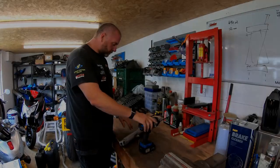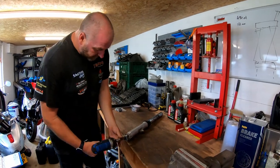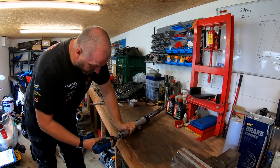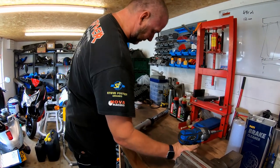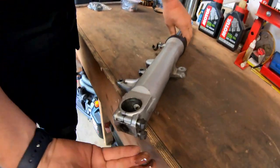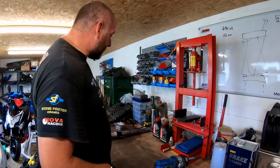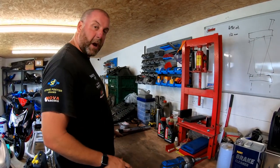We're going to buzz the bottom bolt loose with an impact wrench before stripping it apart - if we don't, the damper rod inside will just spin. We're not taking it all the way out, just loosening it. The fork leg started spinning so I grabbed it - it has come loose and started to weep oil. When we come to remove it later it should come out without any problems and we should be able to separate the damper rod. This is going to be very messy so I need some workshop tissue to protect the bench.